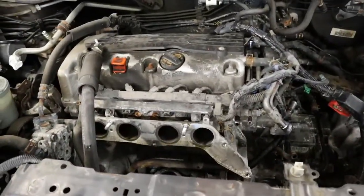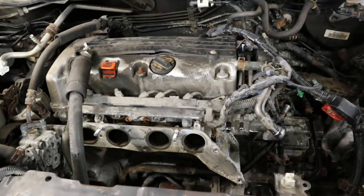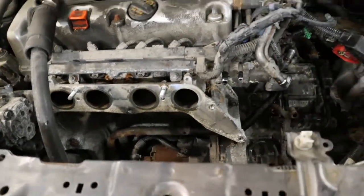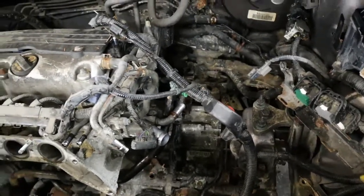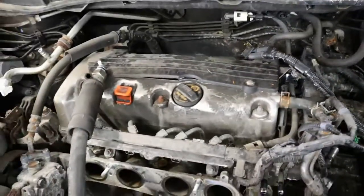Joe from Boulay's here. I'm making some progress removing this engine from the CR-V. I just removed part of the intake plenum out of the way so we don't damage it when we lower the whole transmission and engine assembly. I take it all out as one assembly, so getting the stuff out of the way is the best bet.